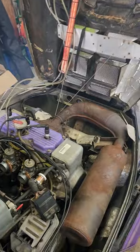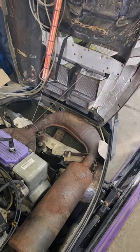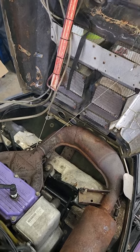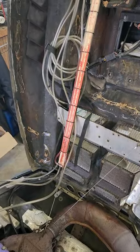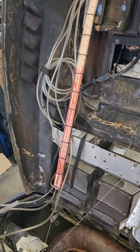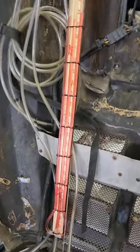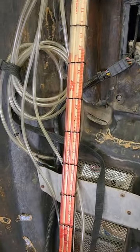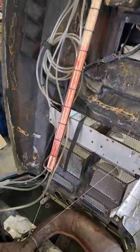The columns that are taller means there's more vacuum on that carb, so you want to allow more airflow and raise that slide. The columns that are low means there's too much airflow, so you need to lower that slide — that creates more vacuum in the cylinder. Again, it's just a yardstick with Tygon tubing zip-tied to it, filled with ATF. You could use water with some dye, two-stroke fluid, or anything you can see — it's fine.